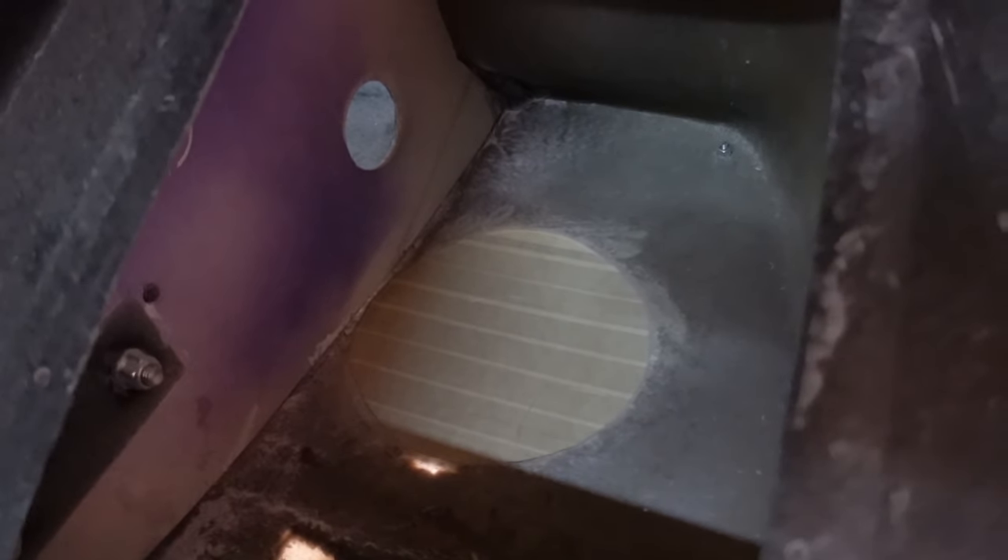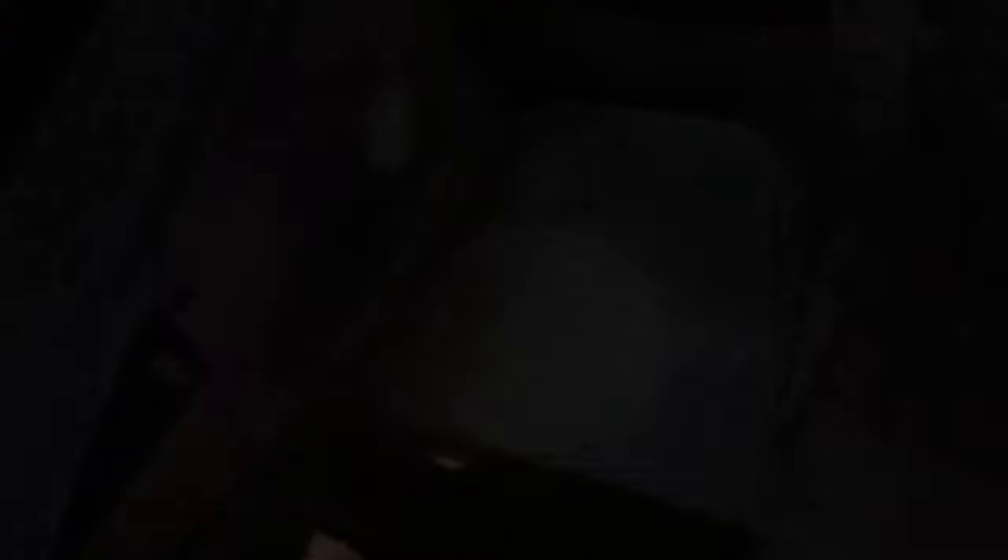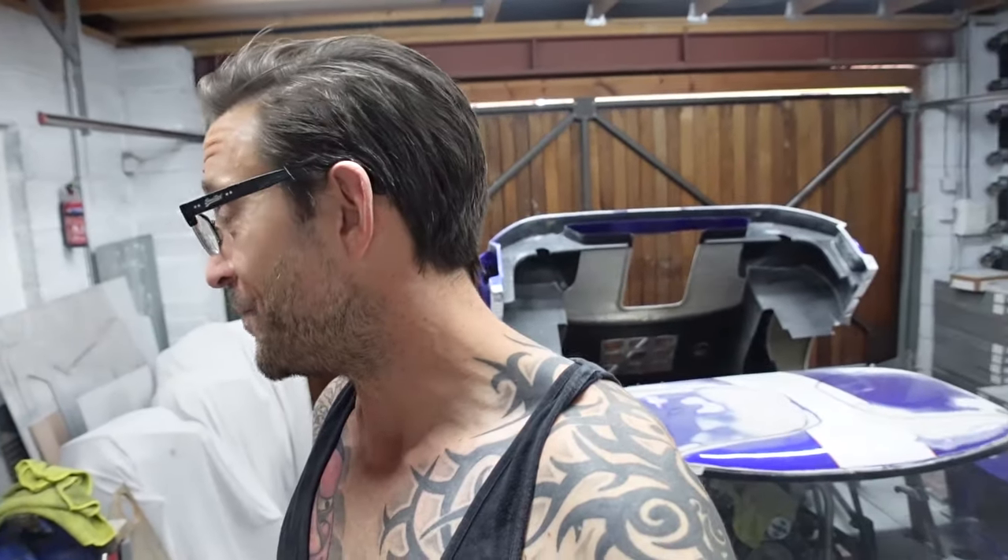I've used a thin corrugated cardboard with a layer of masking tape over the top. Basically what I needed to do was find a suitable object to lay some fiberglass over to create the light bucket I needed to sit the new light into. No word of a lie, I was raiding the cupboard for cans of tuna with a ruler trying to measure the diameter of the cans, baked beans, cat food. There were also some glass jars of jam that I tried - basically something that provided me with the correct diameter of a suitably robust material that I could use four times to pop off four moulds.